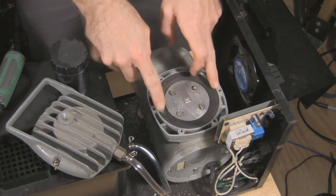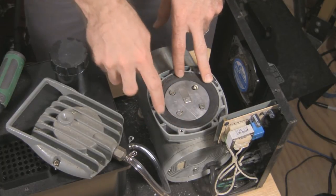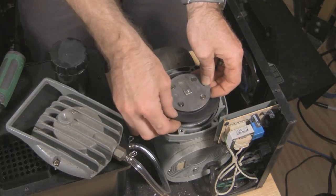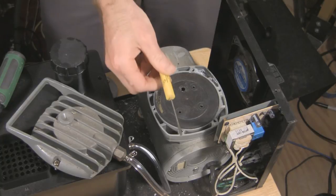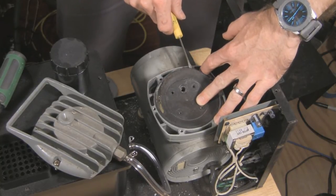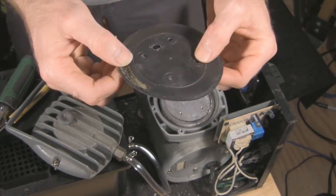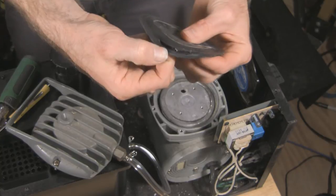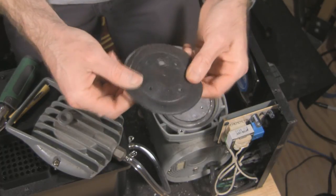This plate holds on the rubber diaphragm that pumps the air out of the compressor and into the oil tank. When I first popped this off, I noticed that the rubber gasket had been split along the edge. I tried to repair it with a little bit of epoxy, but it didn't hold. Then I realized I could buy a replacement part from American DJ for about eight bucks. When you get this top plate off, you might find that the diaphragm is stuck — that's easy to solve. Grab a small screwdriver; there's a small dimple here on the side in the housing and you can get underneath the diaphragm. Here is the rubber gasket — the parts list on American DJ's website calls it a gasket. It's flexible rubber with fiberglass inside, and mine was split really bad along the edge. It definitely needs to be replaced, and this is a consumable part that should be replaced regularly as part of your maintenance on the unit.